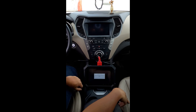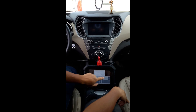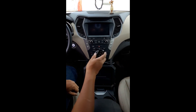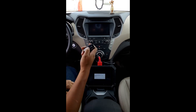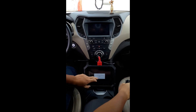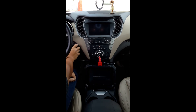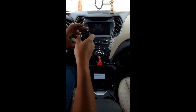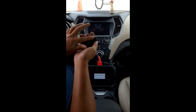Program smart key — ignition switch off. Yes, that's okay. Enter 1-5-7-9-5. Put the smart key close to the button and push it. When it prompts, push it. Hold it close — right here. It didn't recognize it, so push it right on the back part of this one.